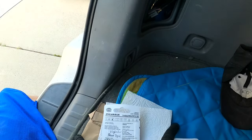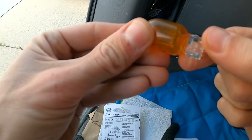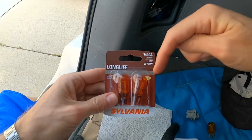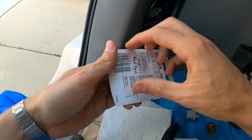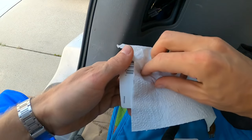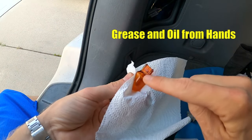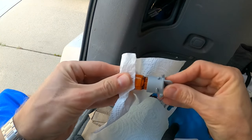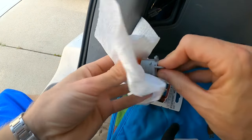Go ahead and pop out this old bulb — it just pulls right out. It doesn't look like it's blown out but it's been giving me issues and sounds a little bit loose. I'll make sure to put links in the description to all those bulbs. Take out the new bulb and be careful not to handle it with your fingers — grab it with a paper towel or put on fresh gloves. You don't want to get grease on the glass part of the bulb because the grease can create a hot spot on the glass and lead to premature failure. Go ahead and snap the new bulb in — make sure it's nice and clean.